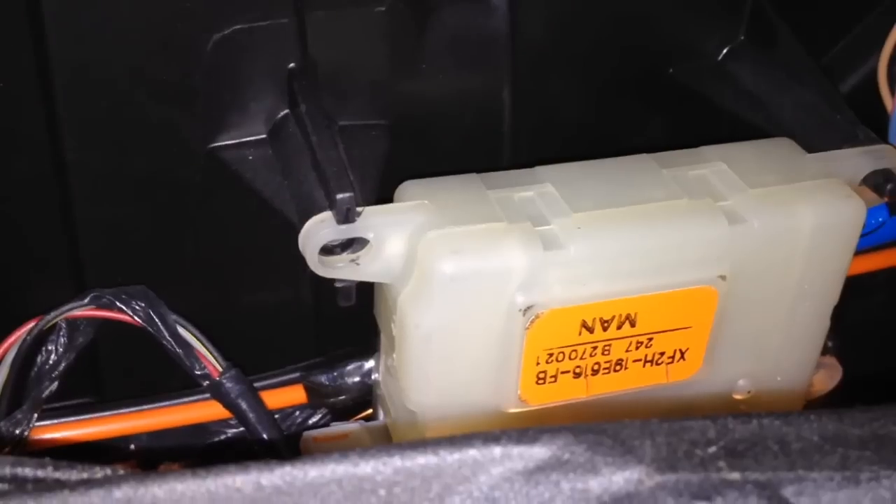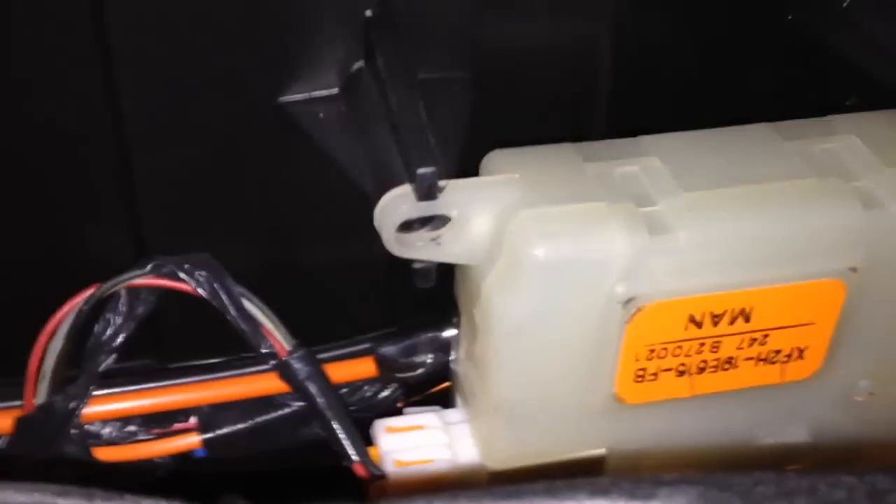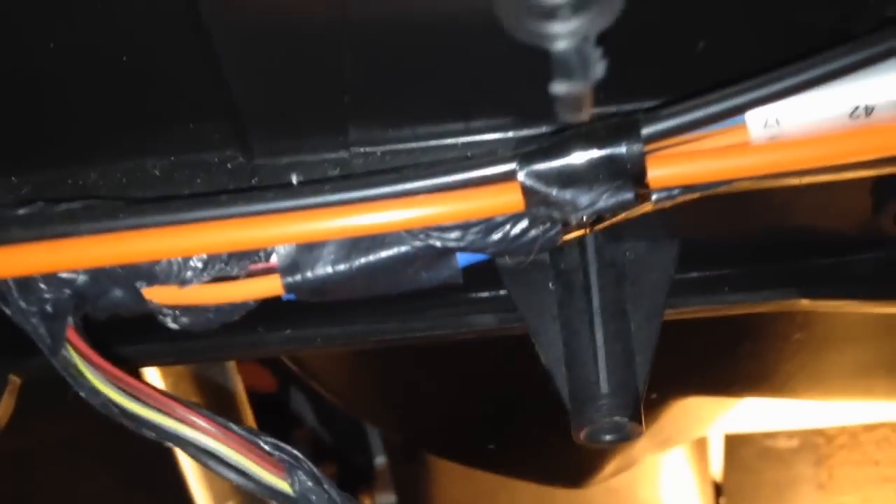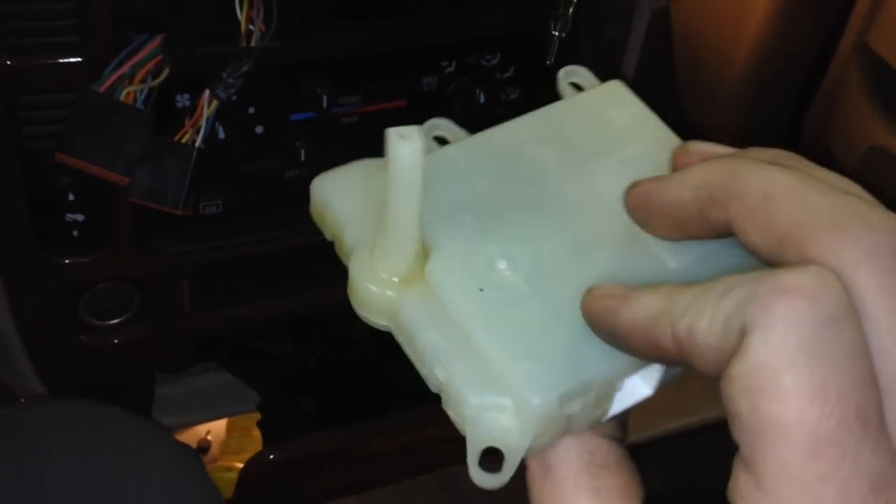You can get to all these bolts without even laying on the ground. It's a little hard looking through the camera but you can see what I'm doing — just these three bolts. We'll deal with that electrical connector, the white one right there. Once the last bolt is out it just slides right out. Press this tang in and pull — and there's the old one.